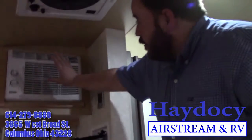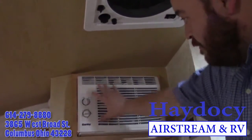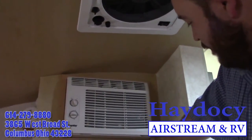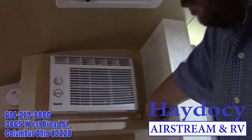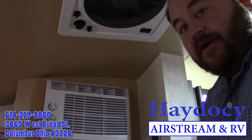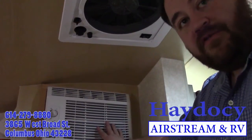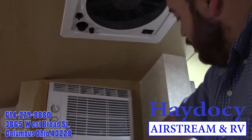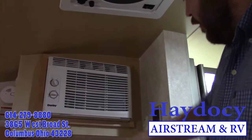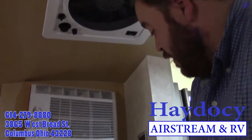All right, air conditioner. Let's talk about the air conditioner for a second. If it's on fan mode, you don't have to worry about this little guy, but it does have an air conditioner fan button over here beside the air conditioner. All that does is help cool it down and regulate the temperature during the summertime when the air conditioner compressor would actually be on. So you don't need it if it's just on fan, but if you do have the air conditioner on, turn on the air conditioner fan button. And that's all that is.